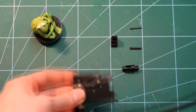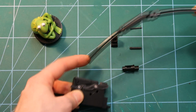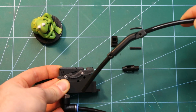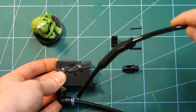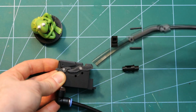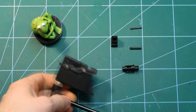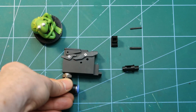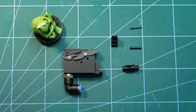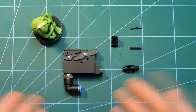And to save yourself some trouble later on, you can just connect the hose that you have in the kit, and put a connector on it. This is the end of the hose, this is the start, but for the test it doesn't make a difference, and you can test the tightness. If the tightness is okay, then it's fine. If not, then try to tighten the valve a bit more, and you'll find out what position is okay. And if you have this correct position, then you will save yourself some time with the disassembly of the conversion later on, in case this is not tight.